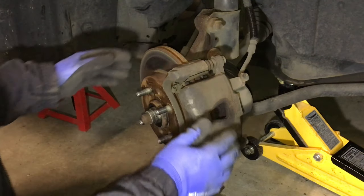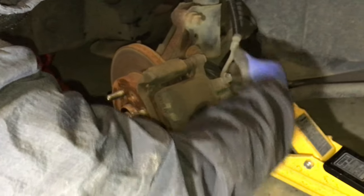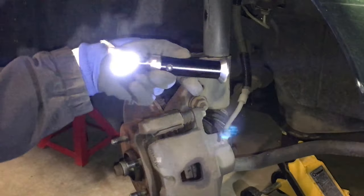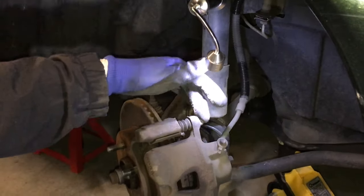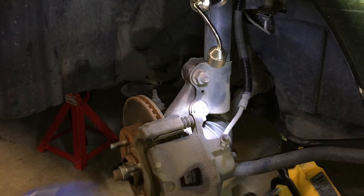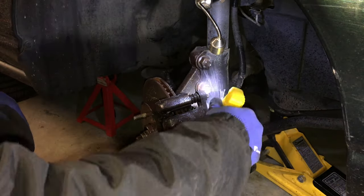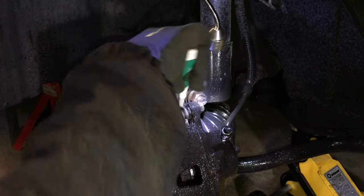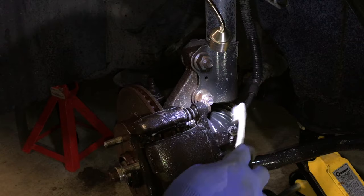The first step is to take a picture of the area you're going to work on so that the brake hose can be repositioned in the exact same position it was in. Before taking the picture, I'm going to soap it down with soapy water. I've placed the magnetic flexible head flashlight onto the strut — that gives me a very good view of what I'm working on without having one hand occupied. I'm gently brushing the boots with an old soft toothbrush to enhance their flexibility, and also cleaning the cap for the bleeder valve.